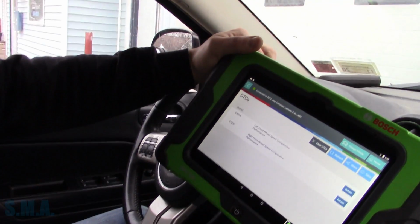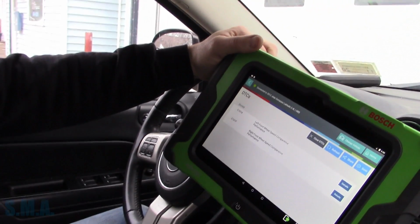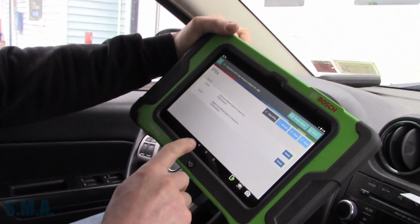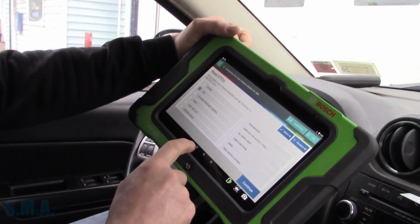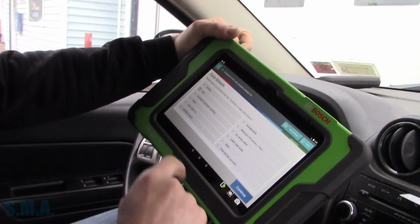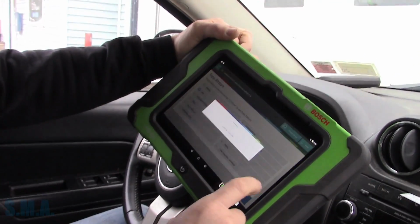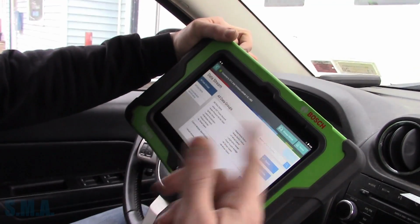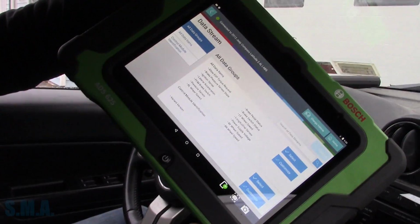Left front wheel speed comparative, right front wheel speed comparative performance. Well, that's a change. I don't know if I've ever done a front wheel bearing, speed sensor, anything on these before. 99% of the time it is something with the rear wheels. I know these have active wheel speed sensors in the back. I assume in the front also.